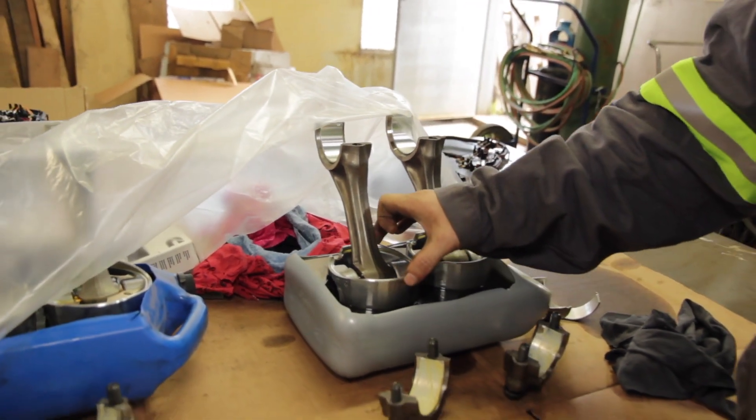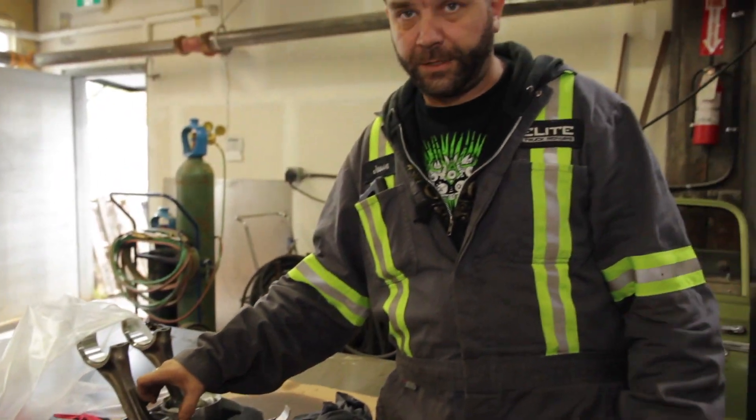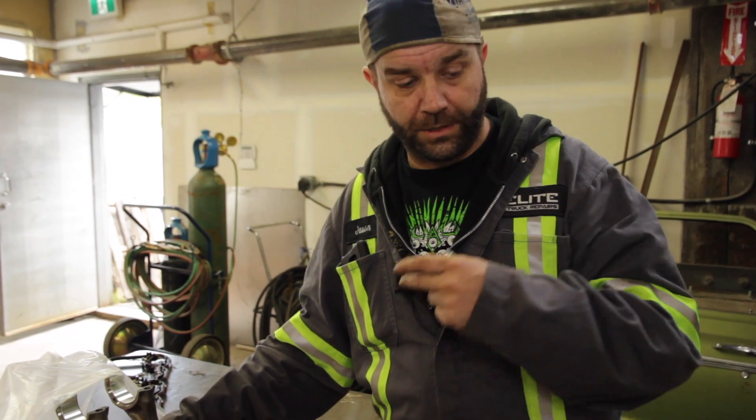That's what happened on this engine, which is why it was diagnosed as needing removal and replacement. These engines don't have replaceable piston liners — they're a solid dry block. So once the cylinder wall is damaged, you either have to pull it all apart and machine it, or in our case, we found a recon engine for cheap.